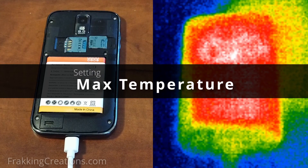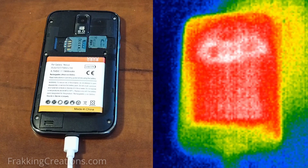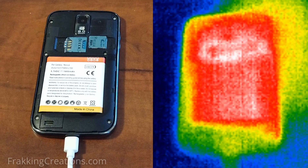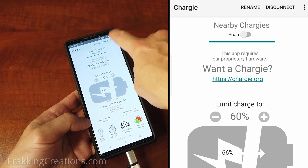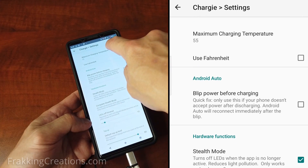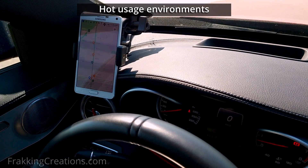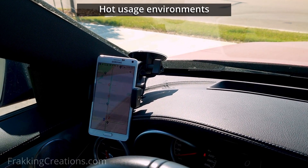Setting the max temperature where charging should stop. Heat is one of the biggest killers of lithium-ion batteries, and the internal protective circuits in the battery and the device tend to have a higher limit than what's healthy for better battery lifespan and capacity. This is because the limit has to prioritize the usability of the device. With Chargy, you can set the max charging temperature lower so that your battery is not charging at too high a temperature, thereby protecting it better. It's typically not healthy to go above 45 degrees Celsius when charging lithium-ion batteries, so configuring Chargy to use this limit can benefit battery health if your battery frequently exceeds it. Just note that if your battery is above your set temperature limit all the time or too often, Chargy will not charge it at all or enough, so set the limit accordingly.